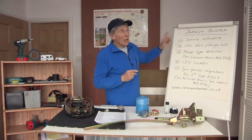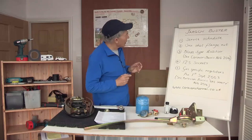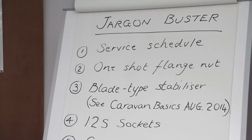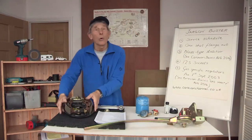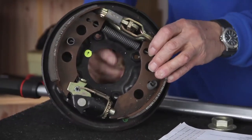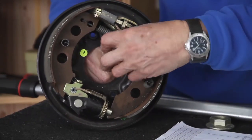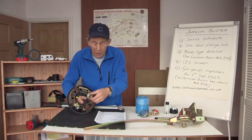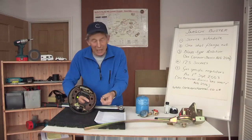When I picked up this I also got a bill that mentioned I'd got to replace or pay for two one-shot flange nuts. What are those for, goodness sake? Well, this is a caravan brake, and over here is the brake drum. There's a stub axle which is threaded here, and once the drum is in place this is screwed on and it holds it all together.